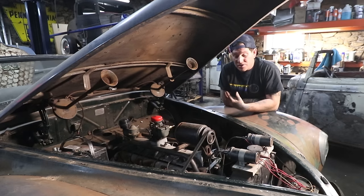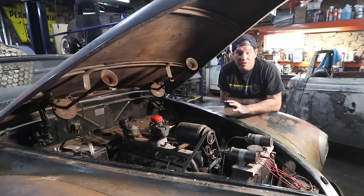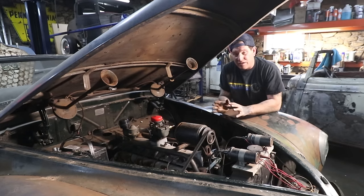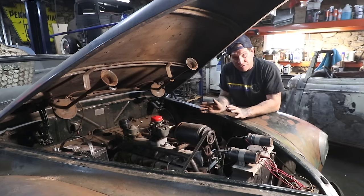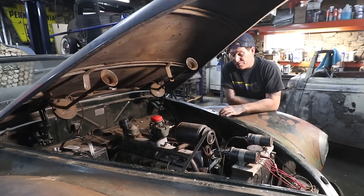I think the engines in both of these cars were rebuilt. The '39 we're pretty much 100% sure was rebuilt, because there's a sticker in the door jamb. With this one, we saw a disassembled V12 engine, like old rings and pistons and all kinds of stuff. It makes me think that it might have been the stuff from when this was rebuilt. So we'll probably do some compression tests and oil pressure checks the next time we run it, just to prove it a little better.